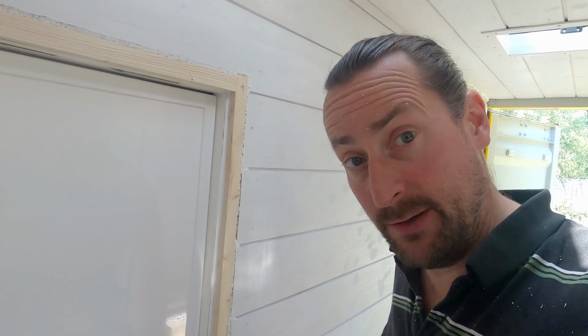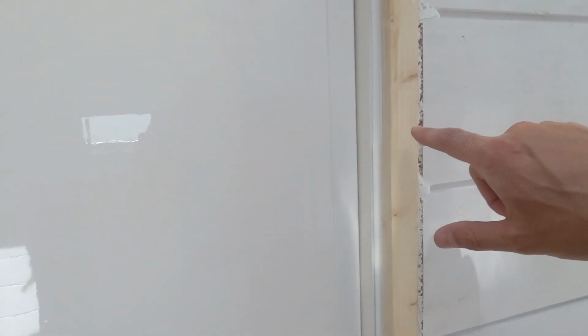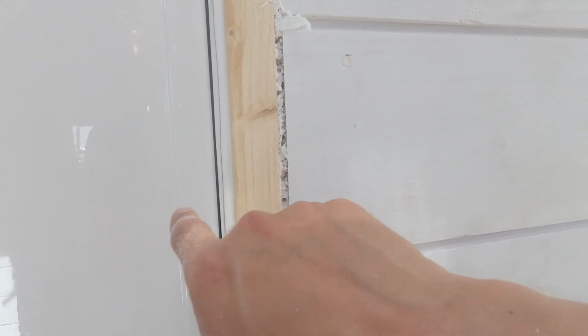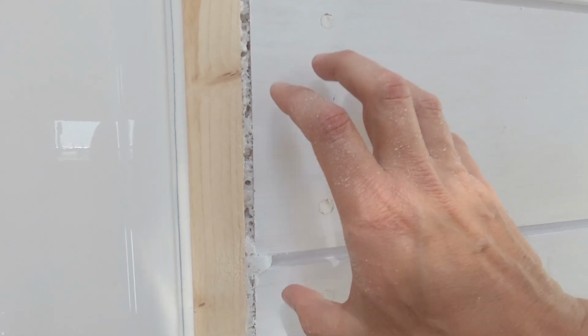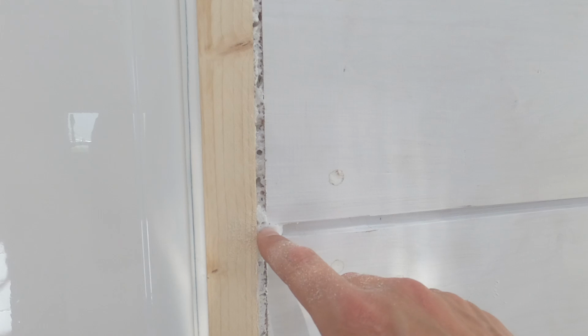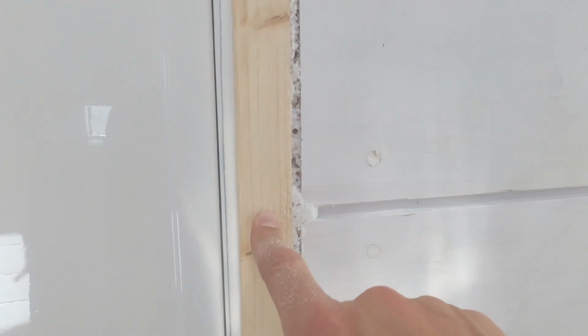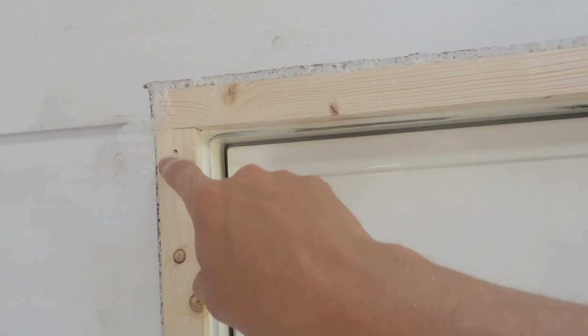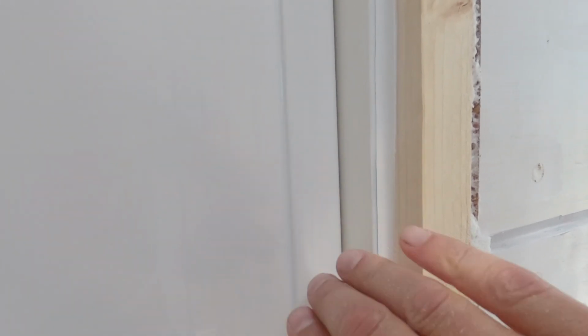So the solution basically was that we filled the gap, or the distance, between the door and window profiles and the wood paneling that we already made. We filled this gap with PUR foam behind it as well, then a wooden frame, and the wooden frame is connected all around and glued to the door structures and the window structures.